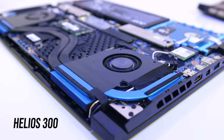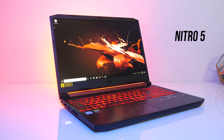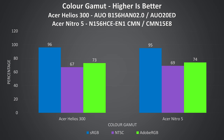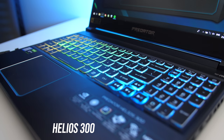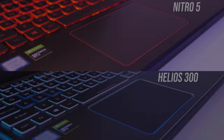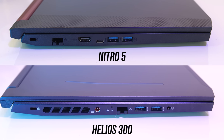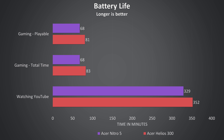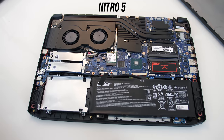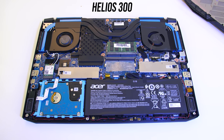The fans in the Helios did get a little louder, however you can customise fan speed on both laptops. Both of my laptops had 60Hz screens though 144Hz is an option too. There were many more similarities including similar keyboards — the Helios does have the option of RGB lighting — similar touchpads and similar speakers. The Helios 300 had slightly better IO, including a mini DisplayPort 1.4 output, and drops the USB 2.0 Type-A port present in the Nitro 5 for USB 3. Despite having the same size battery, the Helios lasted slightly longer both in and outside of gaming. In terms of upgradeability they were essentially the same — both have two memory slots, two M.2 slots, a single 2.5 inch drive bay and WiFi card.